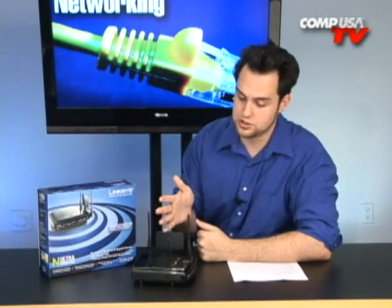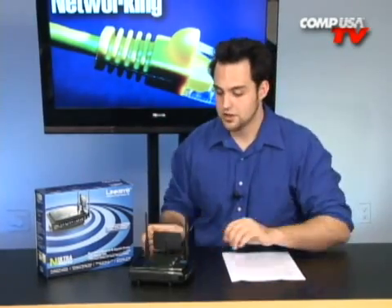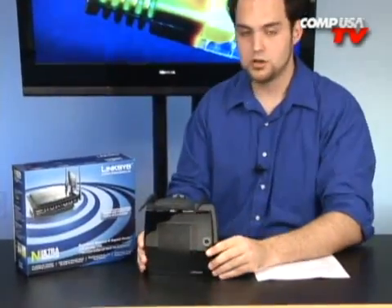Since it's wireless, everyone wants to know about security. You get WEP at 128-bit and 64-bit versions, and also WPA and WPA2. WPA2 is very hard to hack. If you enable it, most people looking for an easy target will move on when they see it.